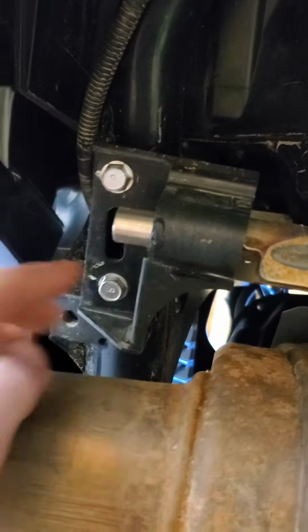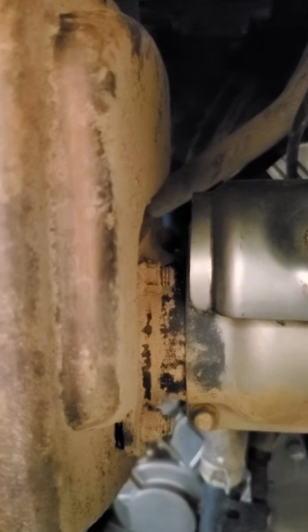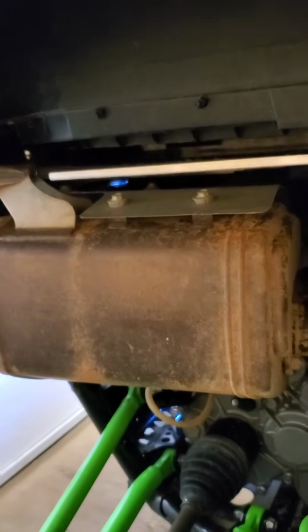Don't remove them. Once you get those loosened, come back here and remove those top two bolts and these bottom two bolts. Once you get the last bolt out, kind of support it with this hand so it doesn't damage the studs on the muffler or the flange for the header pipe. And then just spin these four off, two on the back side, two on the front side, with your right hand. Once you get them off, this muffler is stout. It is not light, guys. Once you get it off, pull it out, and then we'll go to how to get the cat out of there.